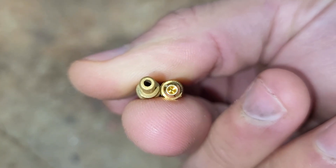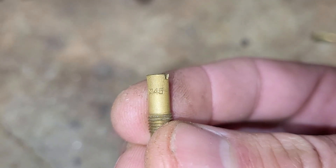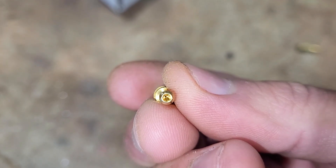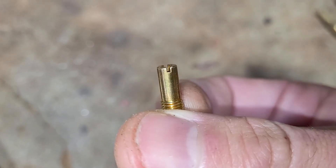The most important part is the little jet hole in there — that's what the number correlates to. On a fake jet, they're not true to size; they'll just be all over the place. It doesn't even have any numbers on it, so you don't know what it's even supposed to be. You'll never get the motorcycle, dirt bike, ATV, whatever it is, to run right with those pilot jets. It's never going to start, and if it does, it's not going to run very long.